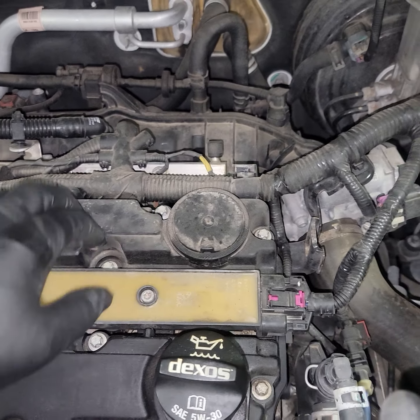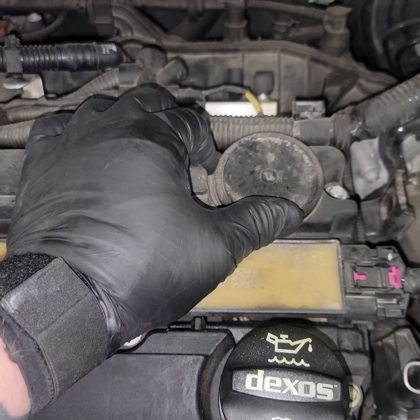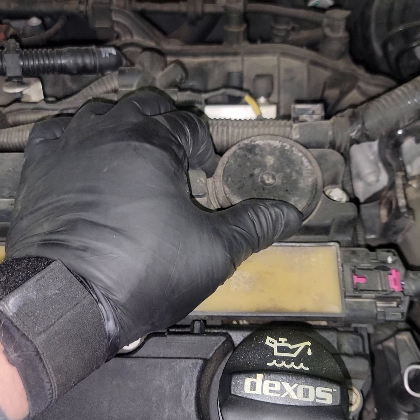So I came out here and I noticed if I plug this — this is the breather diaphragm — after I hold it for a little bit, the engine seems to run a little bit better. Let's see how loud that is. That's sucking all kinds of unmetered air.